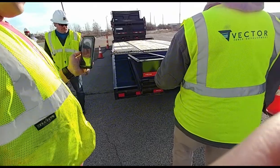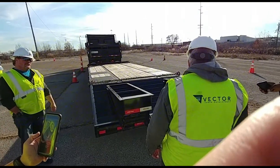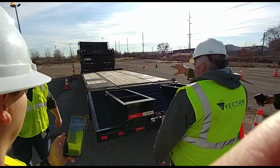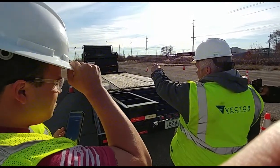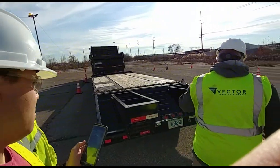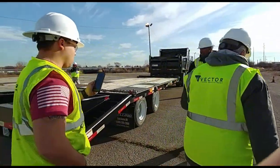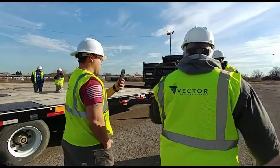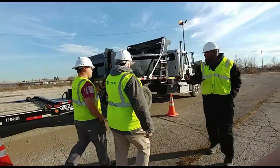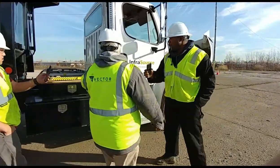I'm going to check my BTT: brake, tail, and turn. Make sure that they're properly mounted and clean. And I have my ID lights. Everything on the back of the truck and trailer is red except for the reverse lights and those extra lights that the company added. The only thing unique on the other side is your exhaust. That's the only thing we have to check. The exhaust is properly mounted and secured, with no loose or missing bolts. There's no rust, no holes, and no signs of soot below that. We don't want any soot that can get inside the cab.